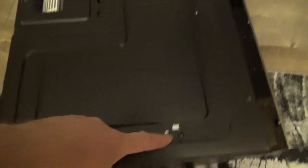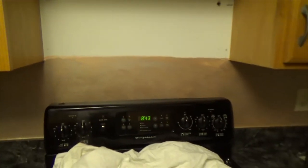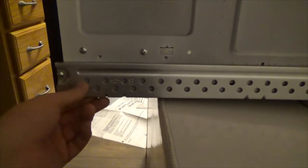These two holes for the two nuts match exactly the same. Now I have to remove this bracket on the bottom — it looks like a J-channel. I'll measure it and go across the bottom, and it's going to be a slightly different mounting setup, actually a little easier than the previous one. I have the line for the J-bracket, which is secured with two screws — one on the left, one on the right — and that's what's going to hold this microwave on the wall.